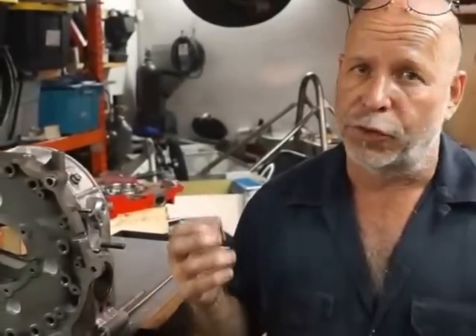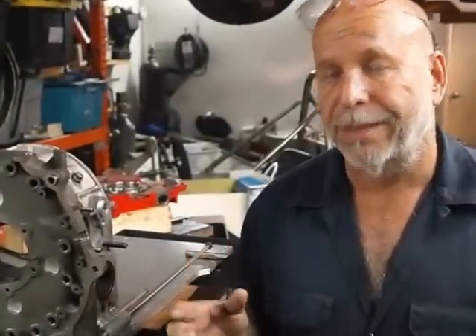The rotors I keep below two tenths of a gram. Mazda, when they built the four rotor engines, considered ten grams to be an acceptable tolerance — but they were only twisting these engines at about 8,800 RPM. We're going an extra 1,200 more. They also had special rotors; we're using production rotors. The J-Spec engine was a purpose-built, totally specialized endurance engine. We're taking a production-based 13B, adding extra stationary gears, and using a custom ground crankshaft made in New Zealand by precision engineering.